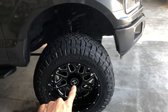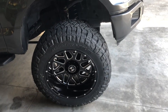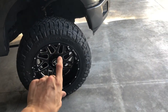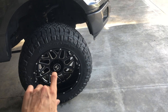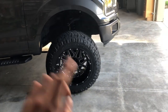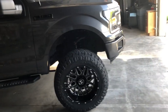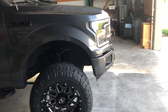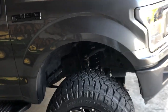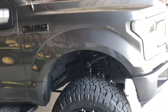You have to measure from the center of the tire, not the overall height. You measure from the center and take half of that difference. So three inches difference — you take half of that, which is an inch and a half, because that is the only part actually raising the vehicle off the ground. So you've got your six and a half inches of lift plus your inch and a half from the new tire, which puts you at eight inches total. So you are at 32 inches from the ground to the wheel well before, and now you are at 40 inches.